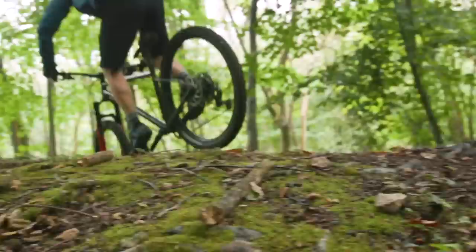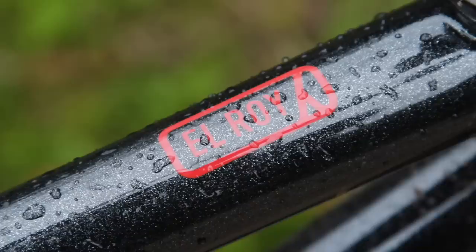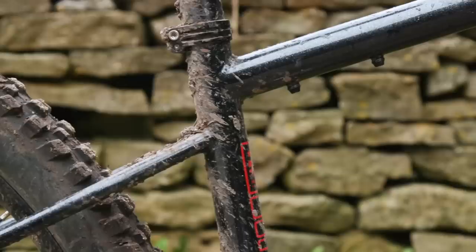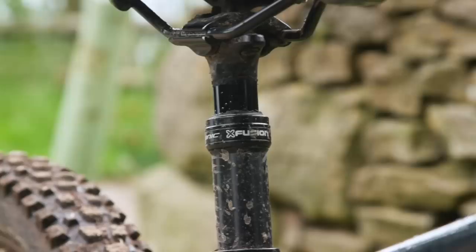The Elroy is designed for those super steep, super gnarly tracks, and if you have a look at it you can kind of tell that that's its bag. The frame is made from 4130 grade chromoly steel and Marin has treated it so it's not going to crumble away after a couple of winters' use. The front end is super long and at the back it's reasonably long to give a nice bit of balance between the wheels. Those drop stays give a bit more compliance to the rear for more comfort when rattling down rougher rocky rooty tracks. Cables run down the outside of the tubes to make maintenance easier, but there is stealth dropper routing for the drop post too.